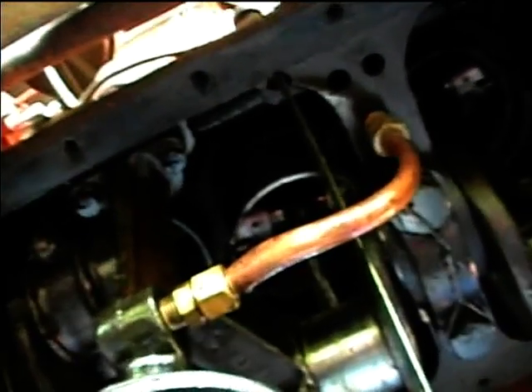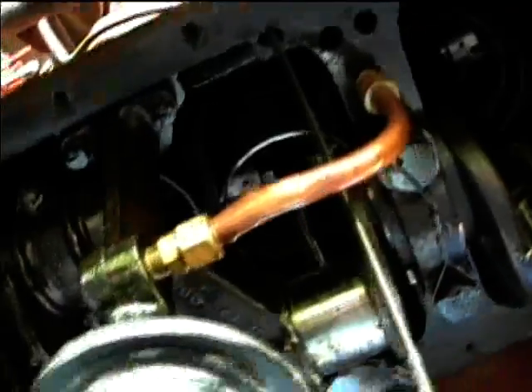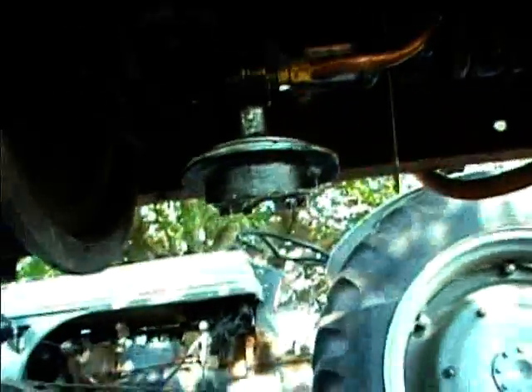I really want to try to get this fixed. If anybody's done engine overhauls, I could use some advice on how to proceed. Here's the oil pump pickup — it had sludge on it. I'm going to have to take off the valve cover and then the head, and push the piston up through the cylinder from the bottom.